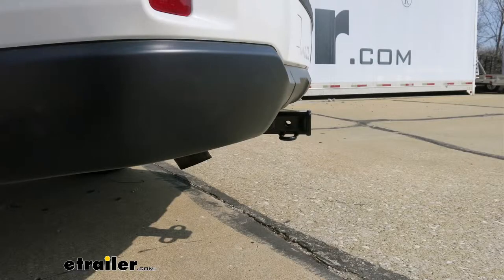I'm going to give you a few measurements that will help you out when looking for accessories for your hitch. From the center of the hitch pin hole to the outermost edge of the bumper is right about three inches — that measurement will help when looking at folding accessories to make sure you have enough room and they're not hitting the rear bumper. From the ground to the inside top edge of the receiver tube opening it's right about 16 inches, which will help when looking for a ball mount so you can match it up to your trailer and find the appropriate rise or drop.